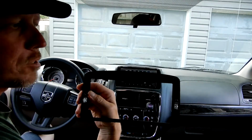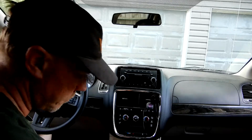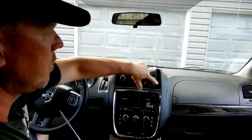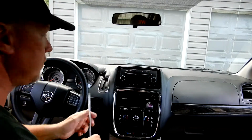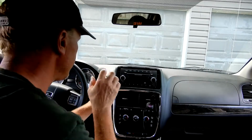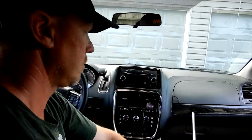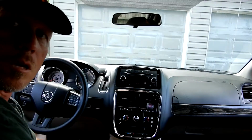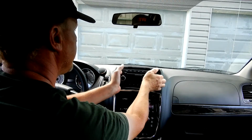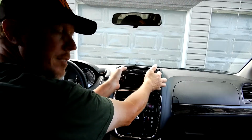Just like that. Just a bunch of clips. Just don't force it. Be gentle. And we have four screws. Two here, two there. So let's take them out. And don't lose them. Okay, four screws are out. Pull the radio out. Little wiggling is necessary.